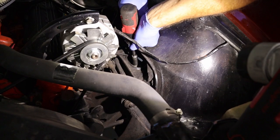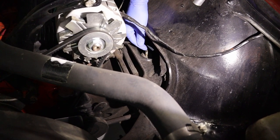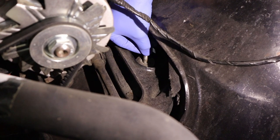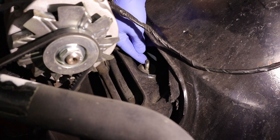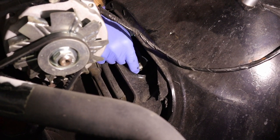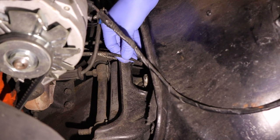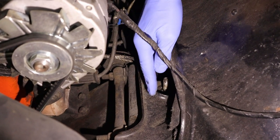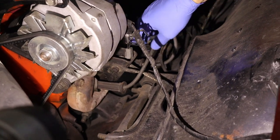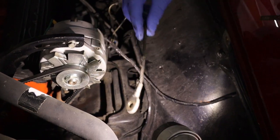Sometimes the whole shock shaft will spin on you — it has a notch on top where you can hold it with vice grips, a wrench, or pliers, while you do the nut with another wrench. Using the impact, it spins fast enough to get it loose. Then take the bushing and old washer off. You can see here that somebody added a GM Performance Parts engine mount limiter, so we've got to remove that because we're changing the control arm. It has a single bolt. We're going to reuse the limiter, so we'll set it aside.